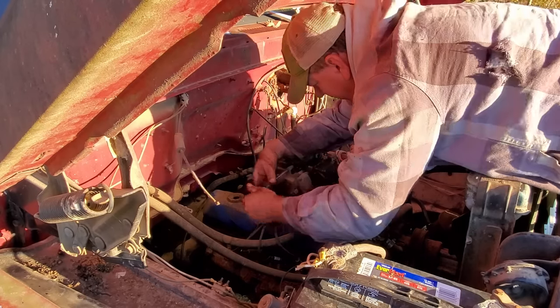It occurred to me after I got the carburetor off that it's the passenger side that's giving trouble. That's the side the governor's on, and it's got a vacuum port here. It goes to the distributor. It works a little valve down in there for the governor part. Well, watch this right here. Here's the vacuum port. It goes up, goes this way, and goes across, and then comes out here.